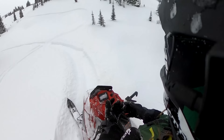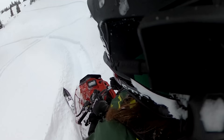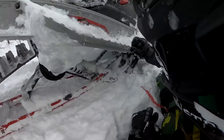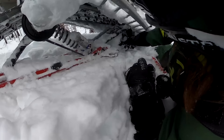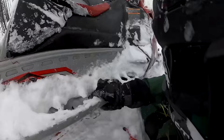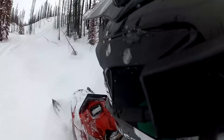As you can see — and I could feel it because I'm the one riding it — there was definitely about six inches more ski lift. It seemed to want to trench more and not actually get up onto the snow and start carrying that momentum forward. So this setup would be if you want it to be more playful — if you want to go do wheelies, bow ties, and hop-overs, that would be a good setup to start with. The third setup I'll show you is what I'd call the most ski pressure, the most planted. That would be to stiffen the rear track shock all the way on the low speed, and soften the center shock completely so it goes through the travel, making a nice mellow approach angle for the front of the track — the sled should just get up on top of the snow and start carrying momentum.